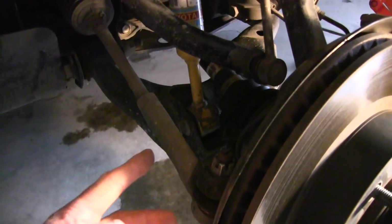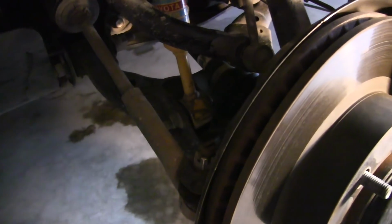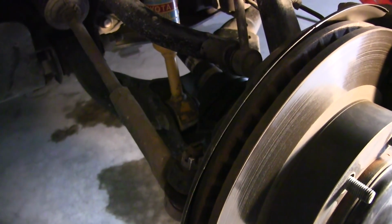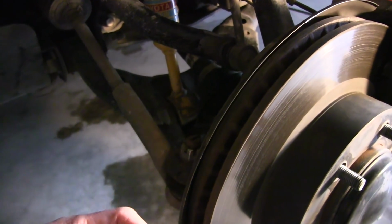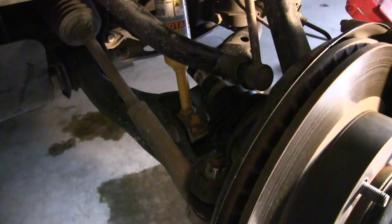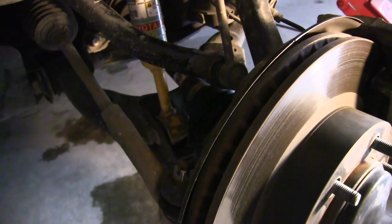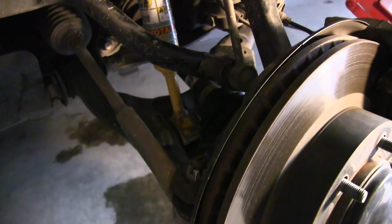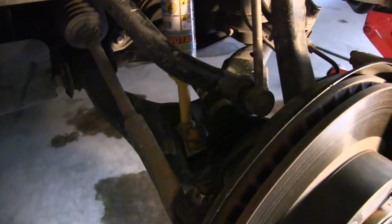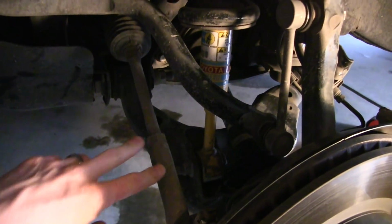To me, it seemed like that's what you do when you're angry or frustrated and working in the garage, not when you're actually trying to get something done. But anyway, you basically hit this guy until it just breaks loose. And then when you reattach it, you just screw it on like any other washer, or sorry, nut. As you're putting the nut on, it sets into place and compresses as needed. So the trick to getting it off is that you've got to hit this guy with a hammer to remove it. So that's to get the control arm out of the way.